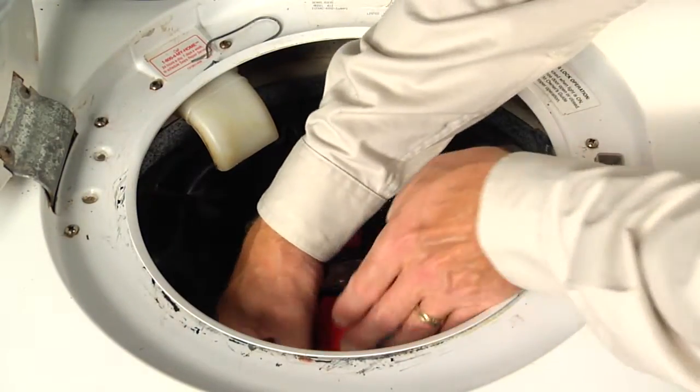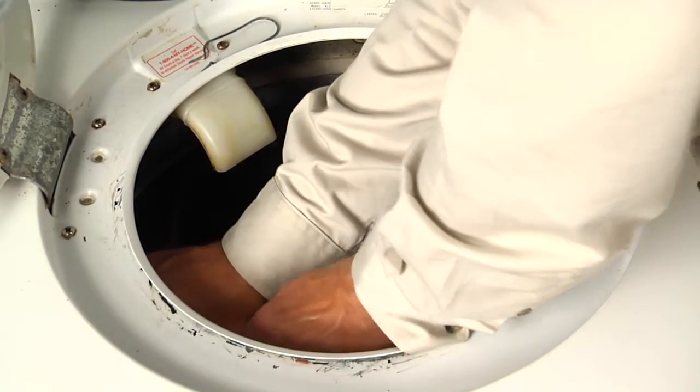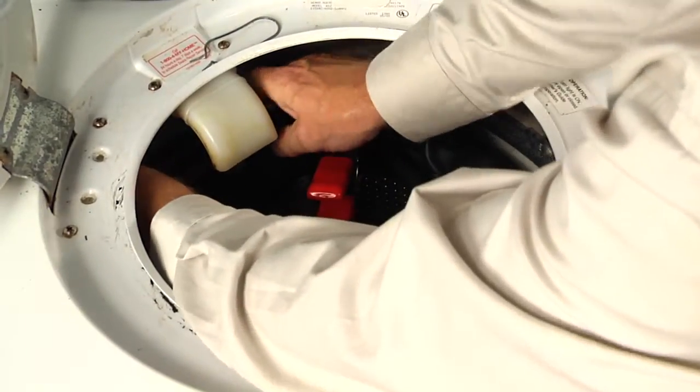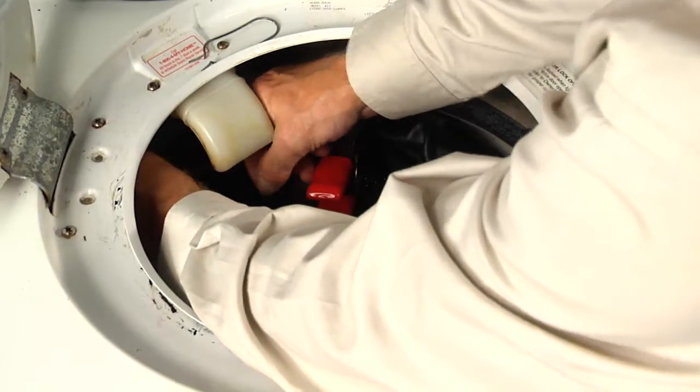And we'll just take that spring, and again, we'll stretch it all the way down to the 6 o'clock position. Take another spacer. Press that into position, and again we'll put a clamp over top of that to hold it there. Now all that remains is to put the spring along the back side. So just stretch that evenly all the way around. Make sure that it stays down in that channel.